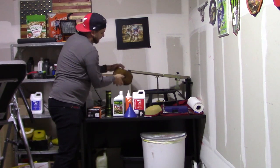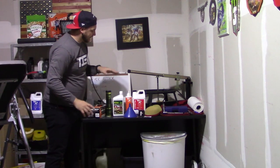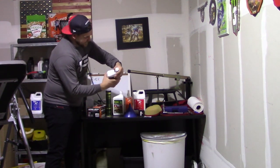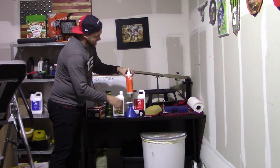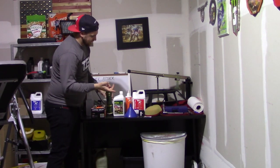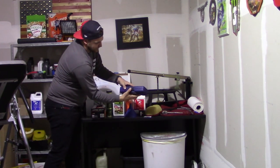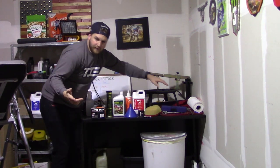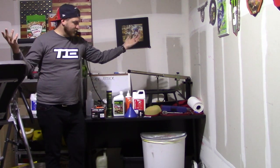Here's one from last time I pulled it out, so I need to get that washed, but I have a whole collection of them here - I'll wash a few at a time. For the oil, we're using the Frontier 10W40, the DO991 edition. Pretty awesome. We have the no-toil air box cleaner to clean out the air box a little bit. Got a funnel. We have the Frontier grease to seal the edge of the air filter. And then we have the Tusk spoke torque wrench so that we can check the spokes. So we're going to do oil, air filter, and check the spokes. It should be a pretty chill, easy day, but you guys said you like to see bike work, so here we are.